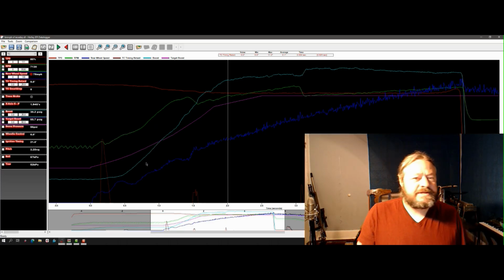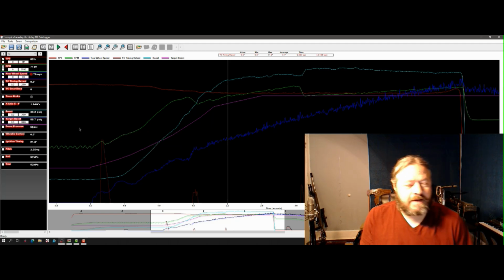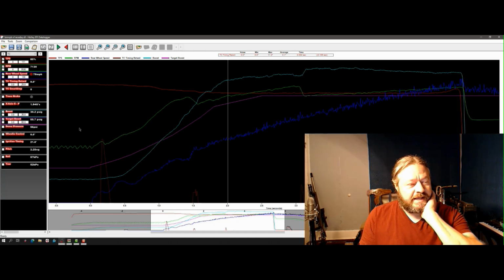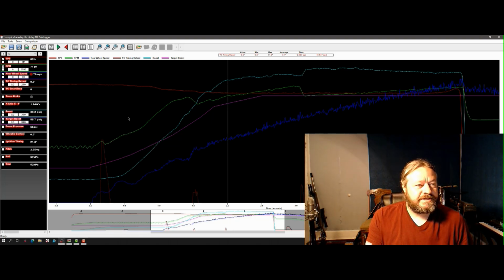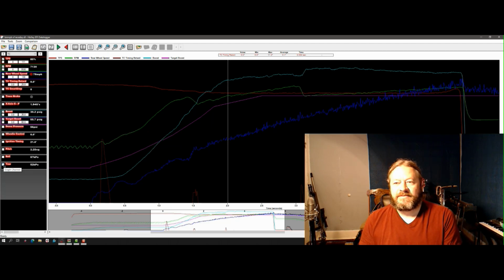Okay, same thing. A lot of times I also use a VPS on this car, most every car. And in the VPS, in addition to looking at G meter, which is crucial, or G data, I'll also look at pitch, roll, and yaw. The reason for this is I can get some idea how much moving around we're doing on the racetrack. This is really important in no prep.